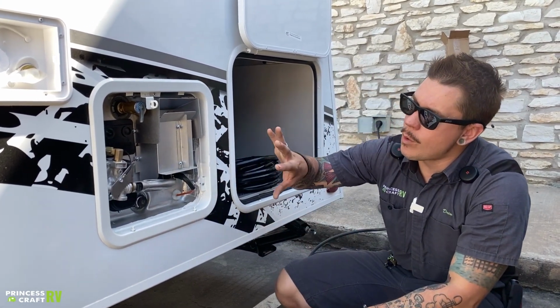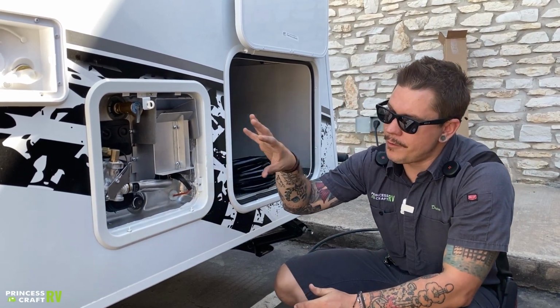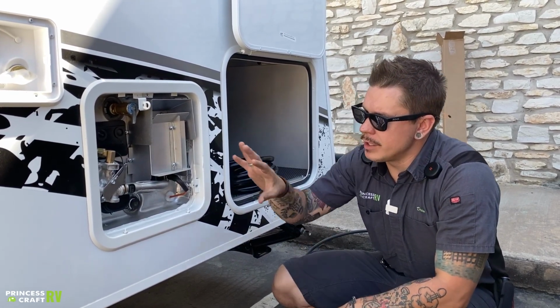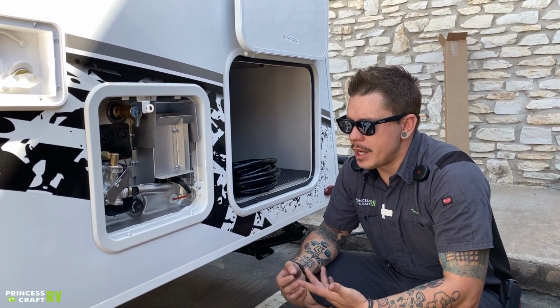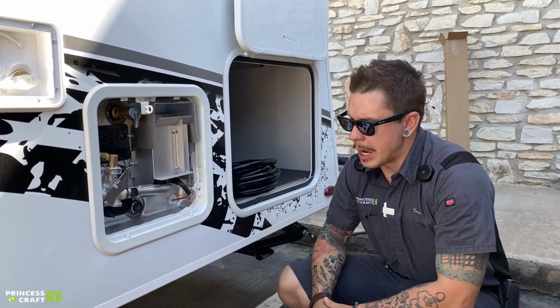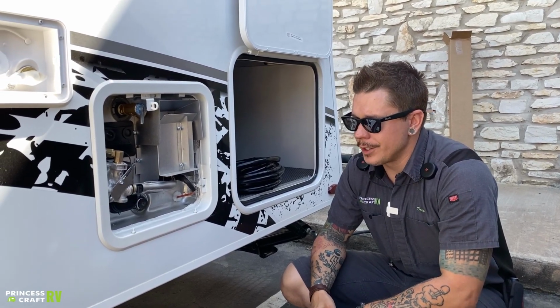We're going to drain the water heater separate of the rest of the system because you're not going to be able to evacuate that water just using the low point drains and things like that. So very important that we do this properly from a safety standpoint. If you kind of fudge it, you're going to open yourself up to some possible scalding or burning issues. So number one, we're going to give it ample time to cool down, at least 2 or 3 hours.